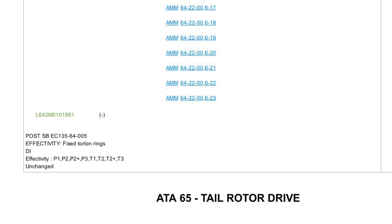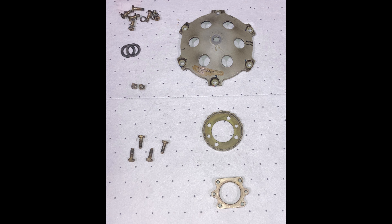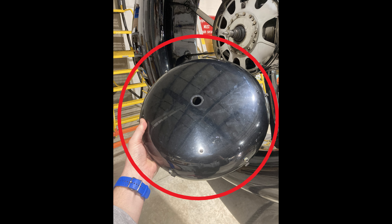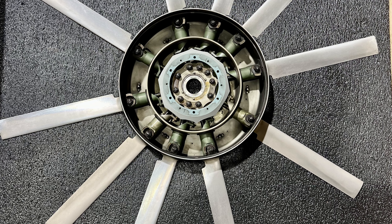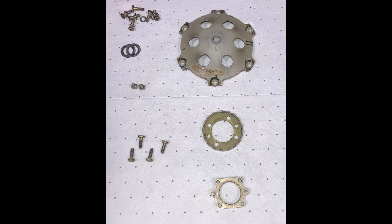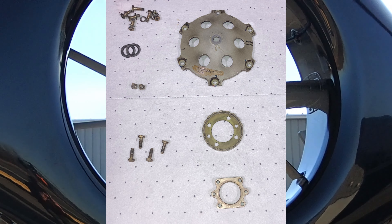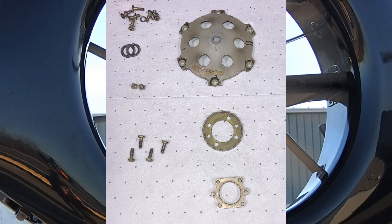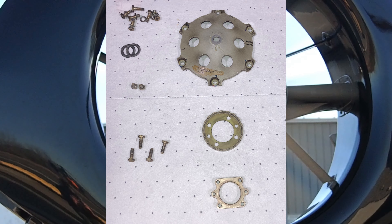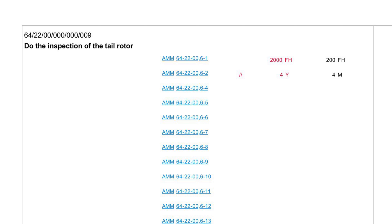We're going to go over that today. If you get a new tail rotor and slap it on, you're going to need to take a look at the thrust nut, the locking washer, the thrust screws, the center flange, and of course the tail rotor fairing — that's all part of the tail rotor assembly. When they just send you a tail rotor, they don't send you those. We used to get them with all these things; recently that's not the case. To prevent you from getting jammed up, just make sure that you sign off the inspection on these other five items that don't come with an inspected tail rotor.